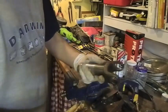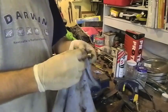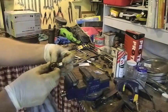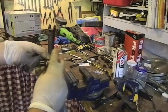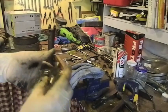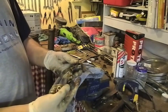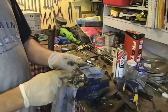Let's take the last uni out of that yoke. These ones here are nowhere near as good as the ones on the back. There's a whole lot of chatter marks all through here - that should be dead smooth. All those rough marks, the grease is over here - they should be dead smooth and rotate freely. This was actually binding as it was going, so that one is well and truly stuffed. The worst part about this - the good one was on the back. In fact, that looks like it's been replaced. It's in really, really good condition. Plenty of grease and it's really smooth. That one you could almost get away with putting back, but I'm not going to bother. This was on the front - you don't want a uni to break on the front because the last thing you need is the tail shaft to drop down and catapult the car.